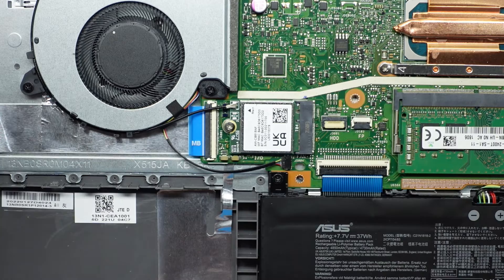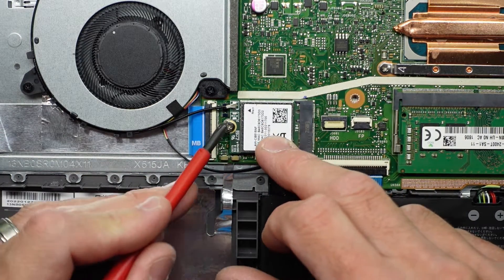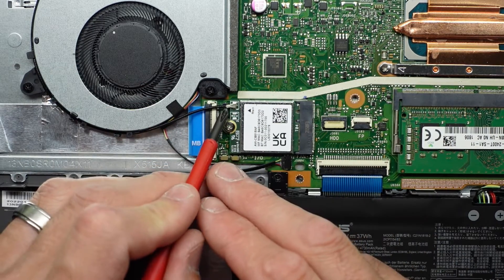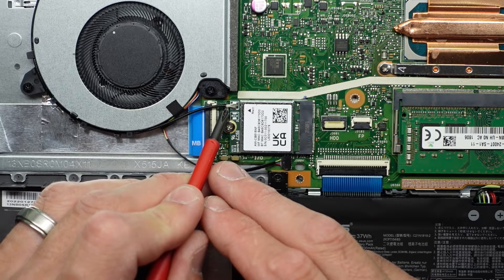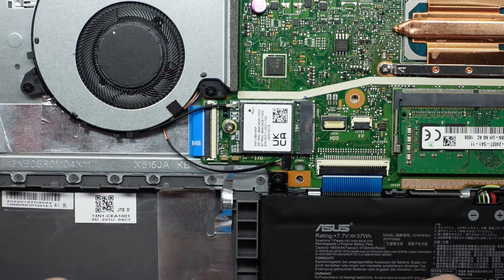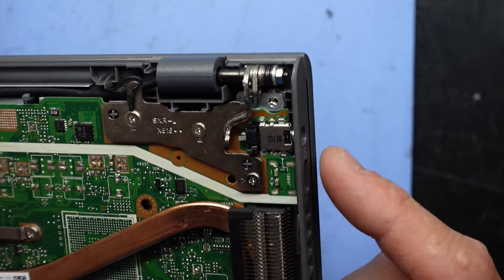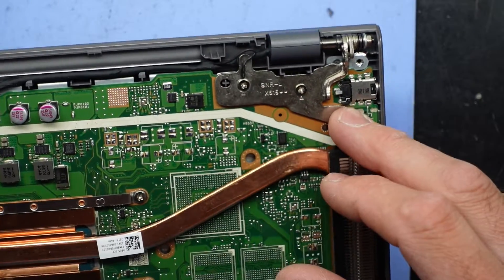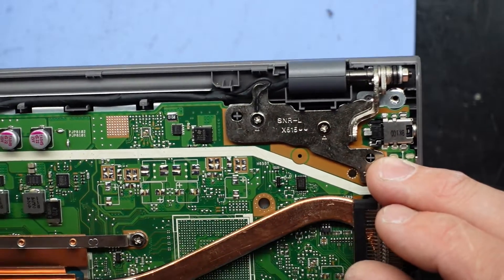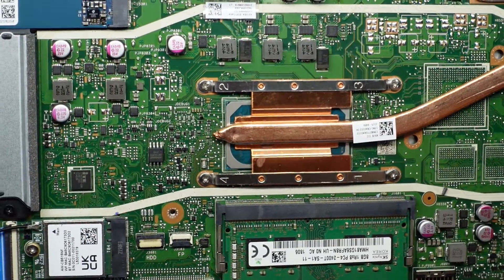There's also a removable Wi-Fi card here — as with the NVMe drive, it's held in with a single screw. It's a little bit tricky to get the antenna off, and there is only a single antenna on this machine, which is slightly odd, but it is a budget computer. Also from a repair aspect, if you damage the charging port, the whole board will need to come out to be replaced. Granted this is a fairly sturdy charging port, so hopefully that doesn't occur.